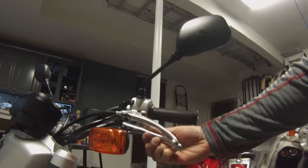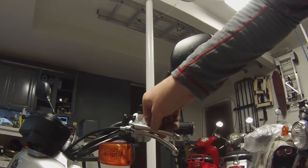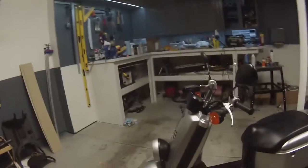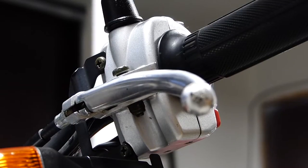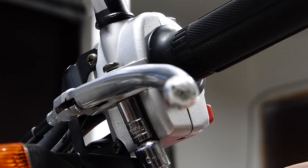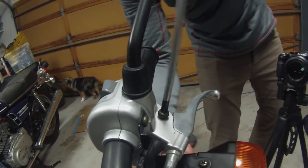Here's the comparison — you can see at the tip it's probably an inch, maybe half an inch lower than where it should be if it was just straight. So what we're going to show you how to do today is pull that off and straighten it out, and then put it back on the bike. What you need for this is generally just a Phillips head screwdriver. A lot of times they're held on with bolts in the back, so it's a pretty easy thing to fix. This bike is a Yamaha C3, and this particular scooter has an 8mm bolt on the bottom and a Phillips head screwdriver screw on the top.